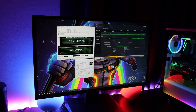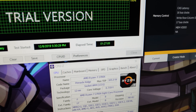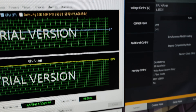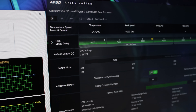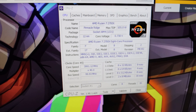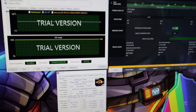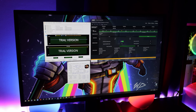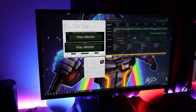Let me put them into the test bench and run through the installation together with all the benchmarks. So we got benchmarking going on right now. We've been running this for one hour 27 minutes and we're getting 57 degrees Celsius — this is from the Ryzen Master tool. I have this overclocked, running at 4GHz. This is a Ryzen 7 2700X, doing a great job. I am using an AIO — because why not, plus it looks beautiful with the white. Let's check out the fans and do some fan tests.